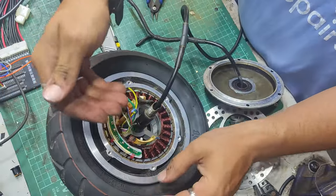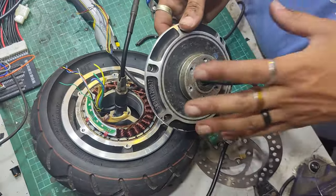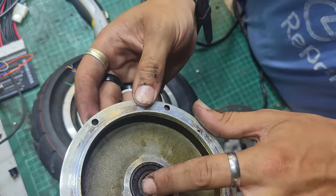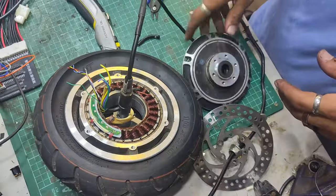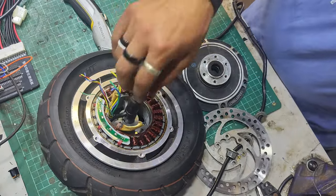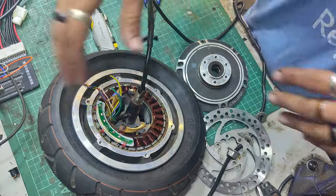The hall sensor I'll have to replace because I'm pretty sure it's knackered. It'll be a case of heating that up, pulling on it - probably won't work, I'll have to lever it out and scrape the bits out, I've done it in loads of other videos. It shouldn't be anything too impossible to do, and then obviously reassembly is the reverse of removal - you put all this back on, the cable fits straight through because there aren't any ends on it. There's a 6003RS bearing on this side cover. Should be fairly straightforward. It's quite obvious what it's doing - a bit of soldering, put it back together, job done. And then I'll replace the inner tube. Thank you very much for watching, have a nice day - like, comment, share, subscribe - YouTube things - and bye bye.